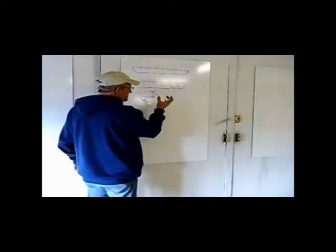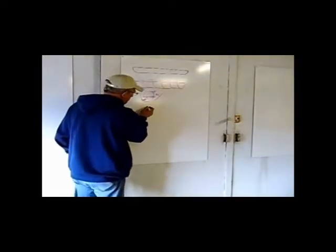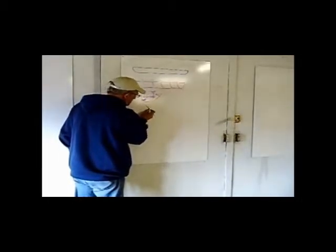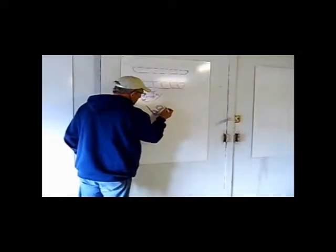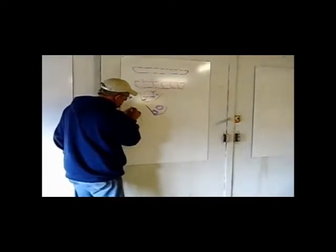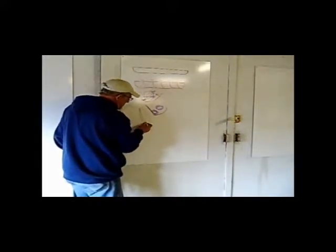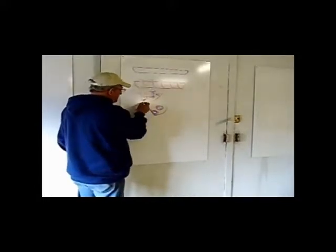That's why it's critically important that you get your left to right as well as your vertical. Because if your vertical is too much, if you're too steep, then the groove comes like this, and the air comes down here, but too much of it catches this way. And this ball of air on this side winds up being too small. If you're too shallow, then the air that's coming in goes this way and starts out in the wrong direction. It's got to come down this wall and roll up this direction to give you the proper effects. So that's why this angle is selected.